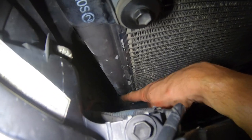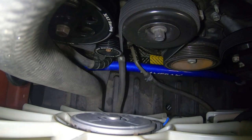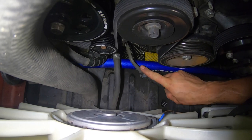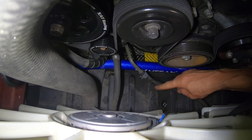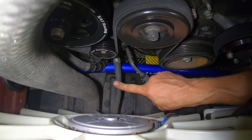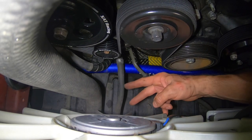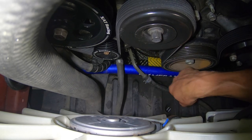The lines will run in here and around this condenser — I think that's a great location. Now, which line do you actually need to tap? These are your transmission fluid lines, and this one here is the one that comes out of the OEM cooler and goes back to the transmission — that is the one we want to tap into for additional cooling capacity. Worst case, if you accidentally tap the input line, you won't hurt anything — you'll just cool the fluid before it enters the OEM cooler.